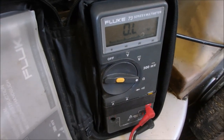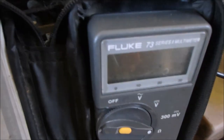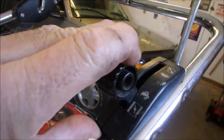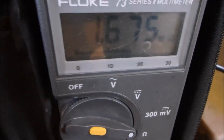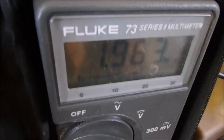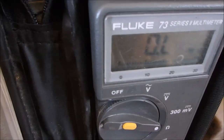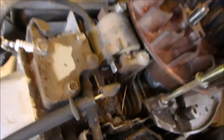I just want to show you something interesting. This is an ohmmeter. I've got the coil unplugged from the shut-off wire. Right now the mower is turned off, and when I go to ground with the ohmmeter I get 0.4 of an ohm — that's a ground. So now we're going to pretend the mower is running by moving that forward, and now we'll ground the ohmmeter — and it has 1.9 megs, so that's basically an open. So as far as I can tell, the wiring is good. The wiring isn't putting a false condition on the coil. So now I think pretty much that it is the coil.